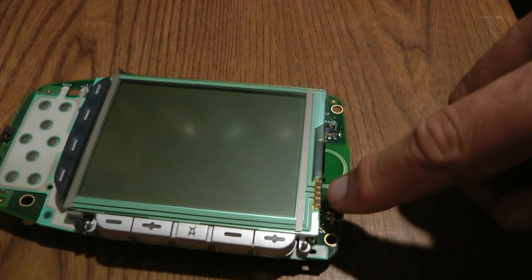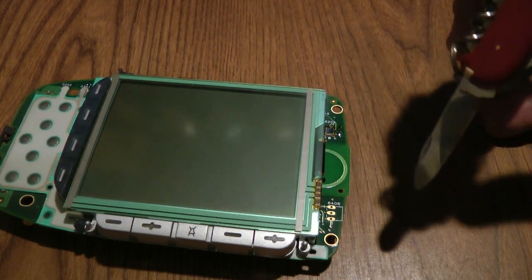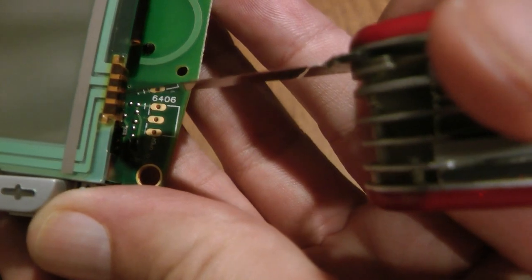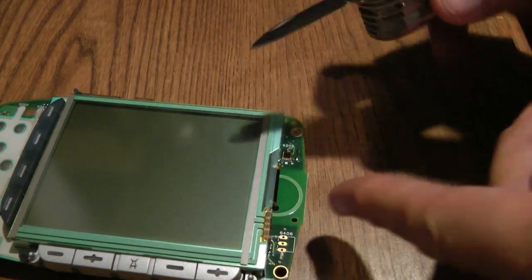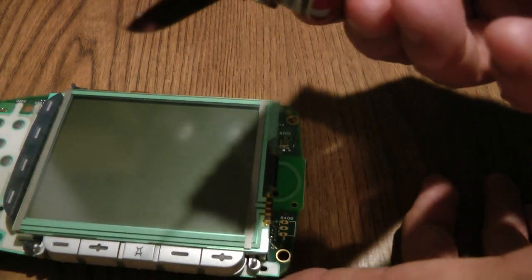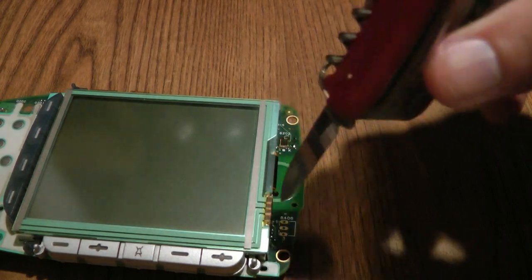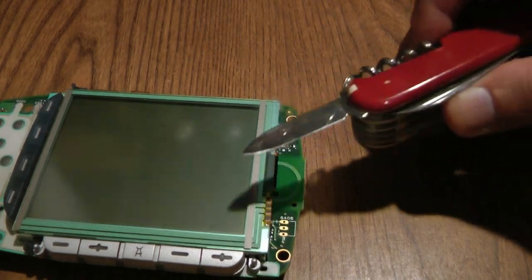The easiest way to fix this is to use a knife or a pen. What you want to do is take the dark brown areas on this remote — these areas here — and just poke some small holes in that edge connector using a little bit of force with a knife with a very sharp point. Just poke them two or three times in different areas in that brown area, and that will clean the connection up so that it makes good contact. Once I did that, the remote started working again.